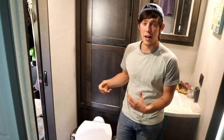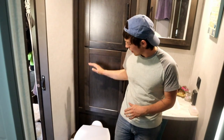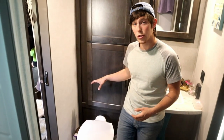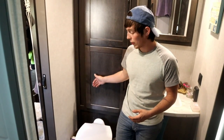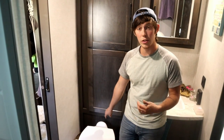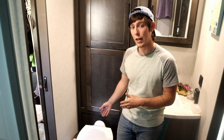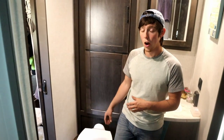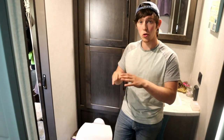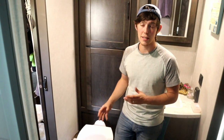One of the big differences between an RV toilet and your traditional house toilet is the reservoir tank. A traditional house toilet has a large tank that stores water so that when you flush the handle it releases that water and gravity-feeds it through the toilet and down into either your city sewer or your house's septic. You'll notice we don't have one of these on the RV toilet. When you press the flush pedal it opens a door and everything in the toilet is flushed down through a tube straight into a black tank, which houses everything from the toilet until you empty it.